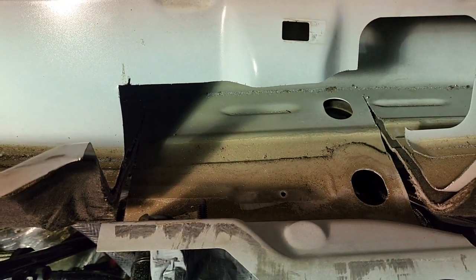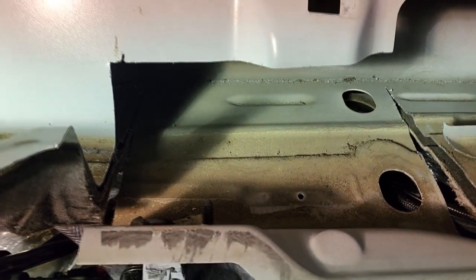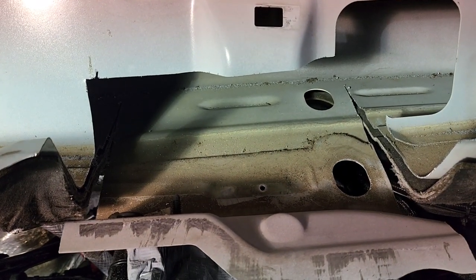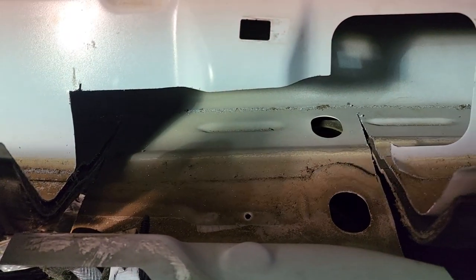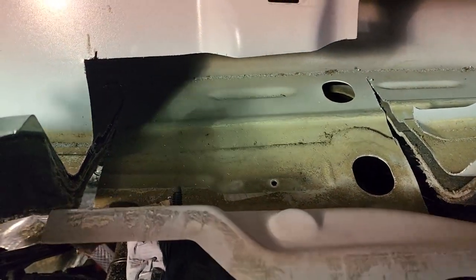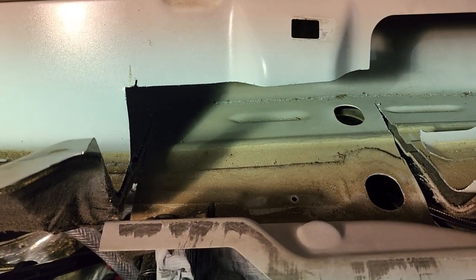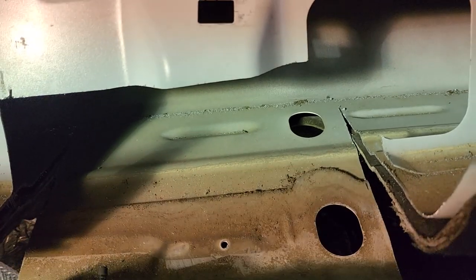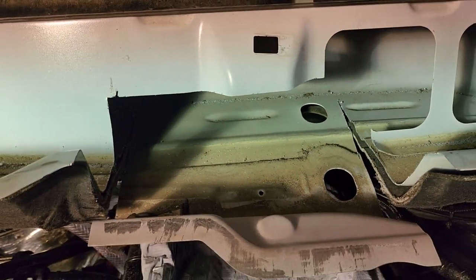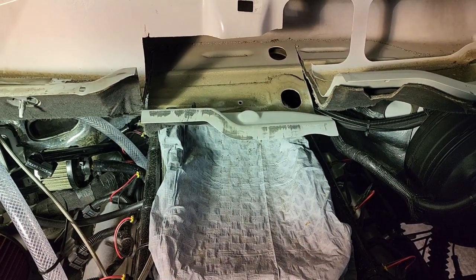And then after that, we should have more than two and a half inches of clearance up here, because the intercooler assembly is two and a half inches thickness overall. So we're going to be raising the upper manifold lid up two and a half inches, and we should have plenty of room here after we finish this last cut.